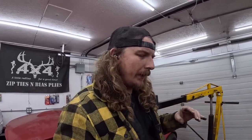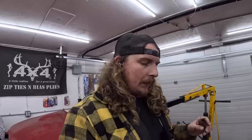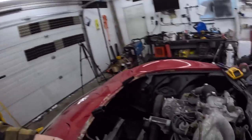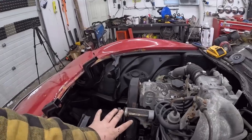Modify the intake manifold to fit around stuff versus put it straight out, and then we've got to screw around with an alternator. I've seen guys do that, and they lower the alternator, and it looks really butchery. So, yeah, stock alternator, and then it's just a V-belt. I'm probably going to have to make some sort of tensioner. I don't remember how it tensioned before, if it was on the alternator, or maybe it was on the power steering, or maybe it was air conditioning. It had all those things. But we should be able to have that dialed.